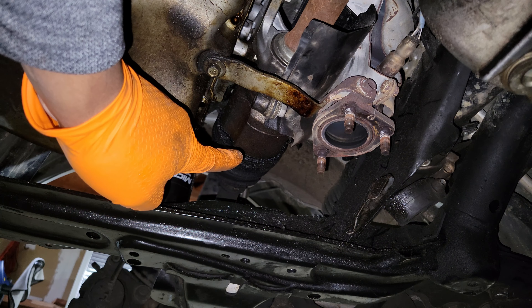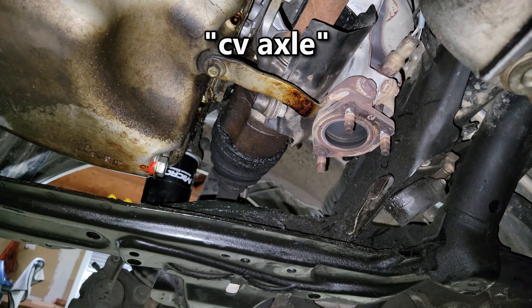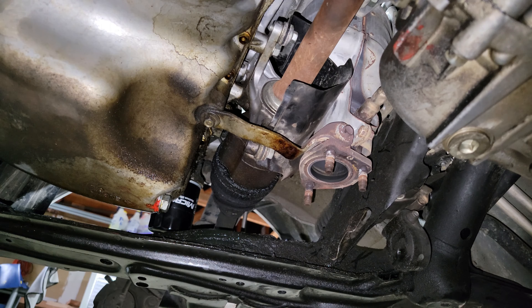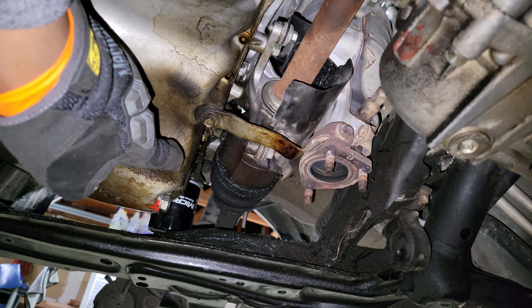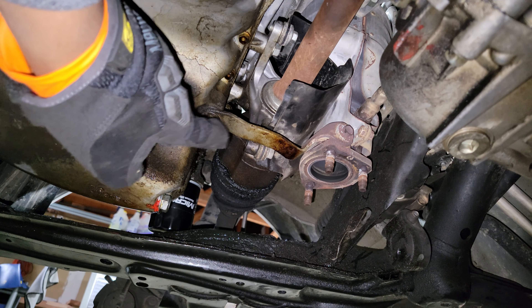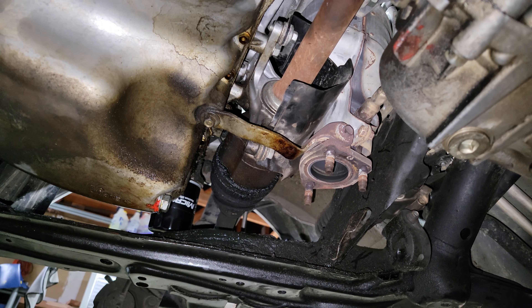There is the rear cat. I can remove it by itself or with the cylinder head. To remove it by itself, the intermediate shaft and drive shafts are in the way — that would require taking apart some suspension to pull the drive shaft out of the intermediate shaft, removing the intermediate shaft, and draining the transmission. So I'm taking this bracket off right here first.